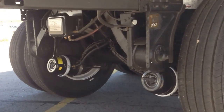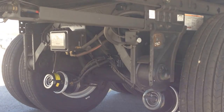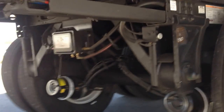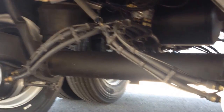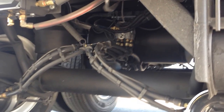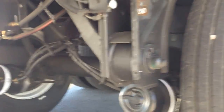This has the new Hendrickson Ultra K suspension installed. This new suspension is lighter and stronger than the older Hendrickson suspensions, and it also has a few other neat features. It has the ZMD airbags on it. You'll notice there's no shocks, so you don't have to do any maintenance or downtime because of the shocks — the shocks are built into the airbags. It's a zero maintenance dampening system.